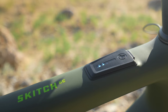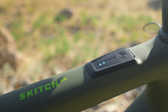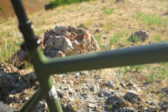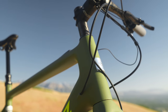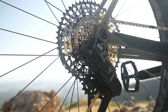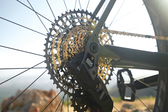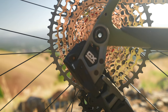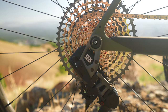The bike is available in both drop and flat bar configurations, both of which come in in the low 30s on the scale. Both flat bar and drop bar builds are designed around 700c wheels with tire clearance up to 50 millimeters. The geometry falls somewhere between a modern gravel bike and a steep mountain bike — the head tube angle is 69 degrees, slacker than most gravel bikes but steeper than most modern mountain bikes. I went with the double XL frame, putting reach at 450 millimeters with a rear center at 430, giving an 1135 millimeter wheelbase.